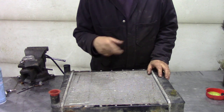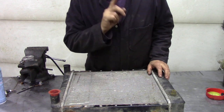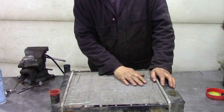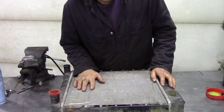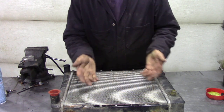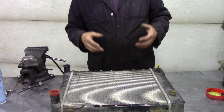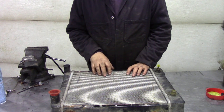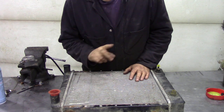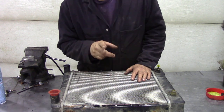But if you see a big pool of fins, rubbish, and corrosion coming out, then it's time to fix your radiator before it lets you down. Because it's made of copper and brass, the fins corrode because there's less surface area. With all the rubbish getting kicked up from the car in front, or driving through salt in winter, the fins in the old type of radiator corrode at an alarming rate. You've got heating and cooling cycles, and salt doesn't like that — it eats into the metal. So power wash out your radiator.